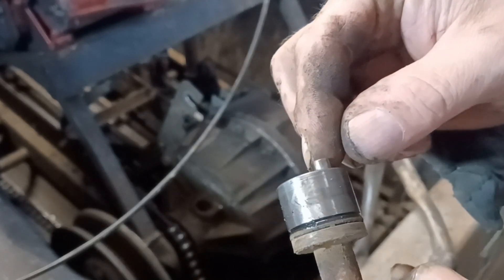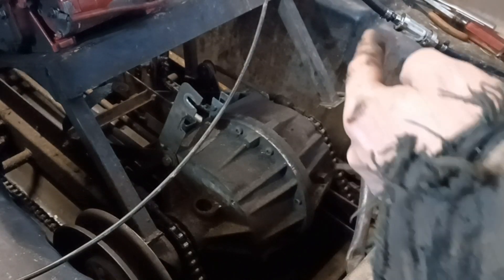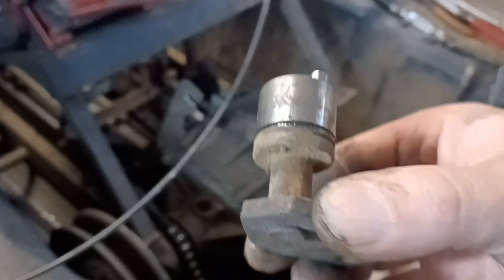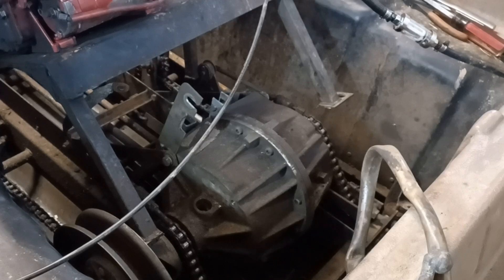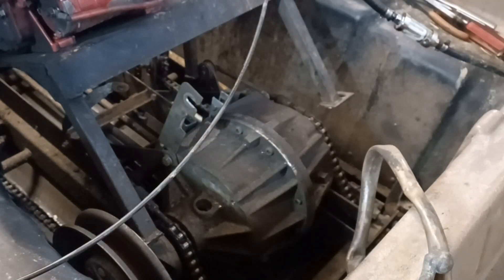That side came out as well. The pin looks fairly clean but this looks really, really dirty. There is a left and a right side to these so I don't want to get them mixed up - I'll keep these with their respective sides. I'm going to get these cleaned up, stick them back in, and hopefully we can get it to shift properly. After that, we're going to have to adjust those arms that come back for the shifter linkage itself and try to get those balanced so it'll shift a little better.